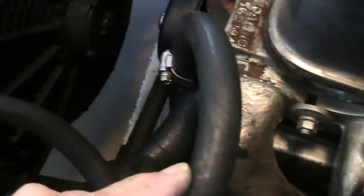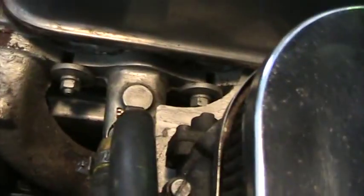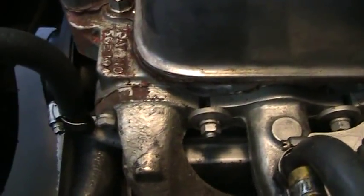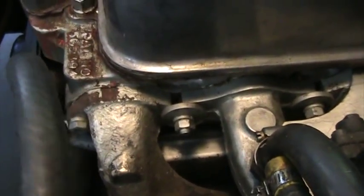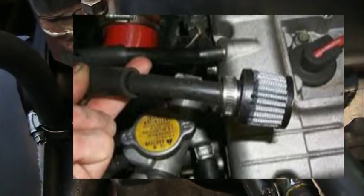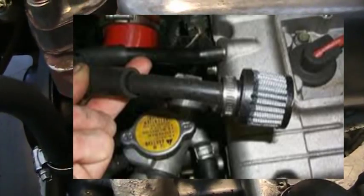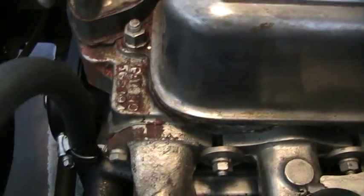I bought this canister. The hose comes across. The vapor that comes out of there is kind of moist — the oil is churning around inside the engine, the engine is trying to breathe. The air that comes out is saturated. A lot of people put just a filter on there to try to stop the oil, like the old tractors and old forklift trucks. It just spewed that fume out in the atmosphere. Well, that isn't the way you do things today.